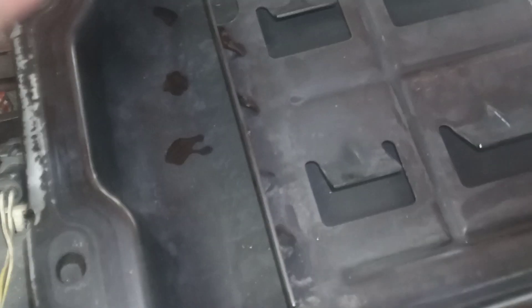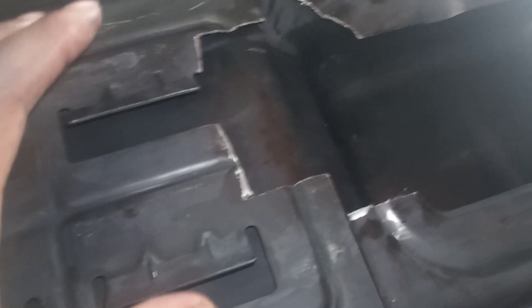I don't believe this will cause any significant damage to how the oil is supposed to be picked up — we still have plenty of windage. The way they build these, the bottoms of the oil pan are almost built-in windage trays. So just because it doesn't have a separate windage tray doesn't mean you need one. You could almost go with the oil scraper and leave this alone. But if you go this route, you can get a Cobra pan that uses a high-volume oil pump — those will fit — or a zinc pan from Summit for around a hundred bucks.